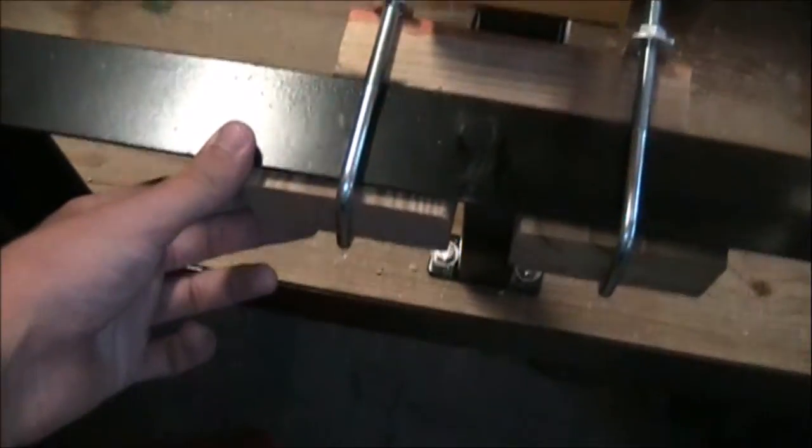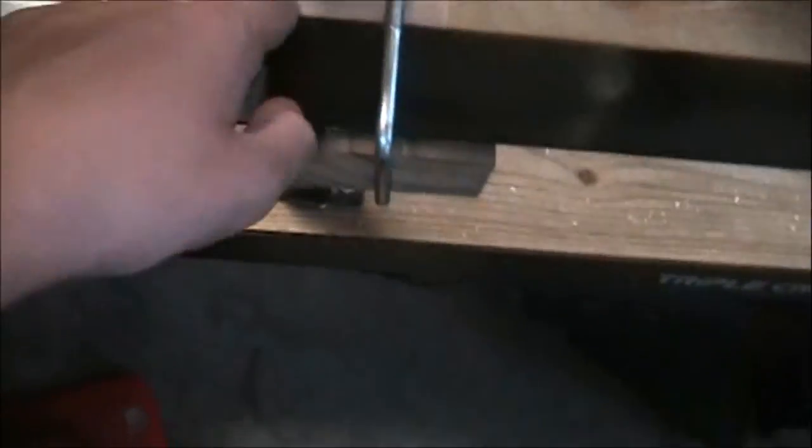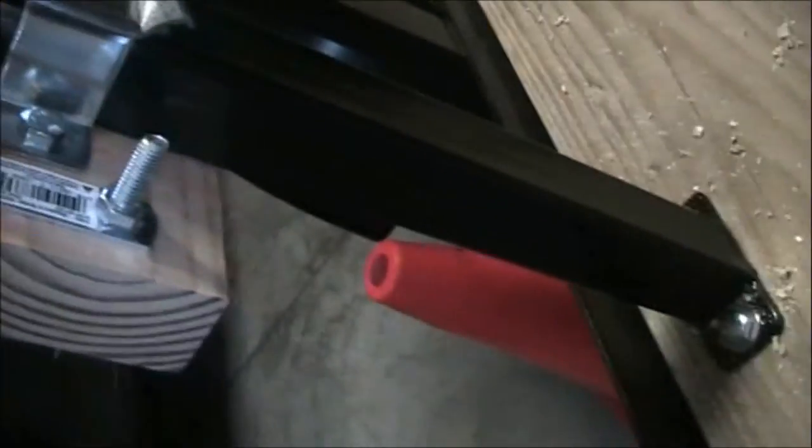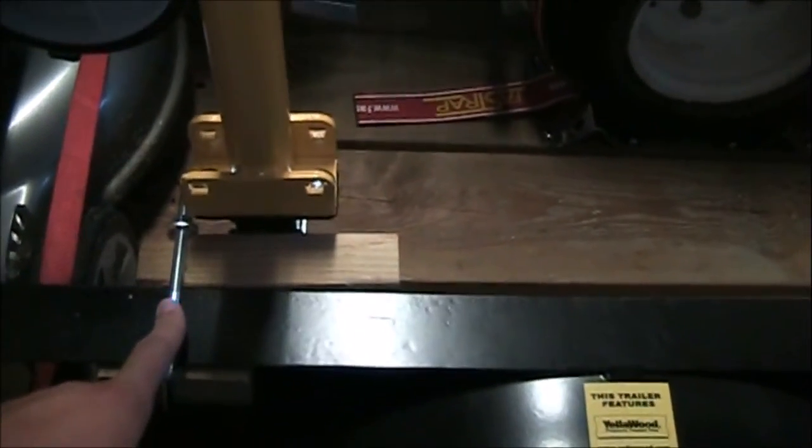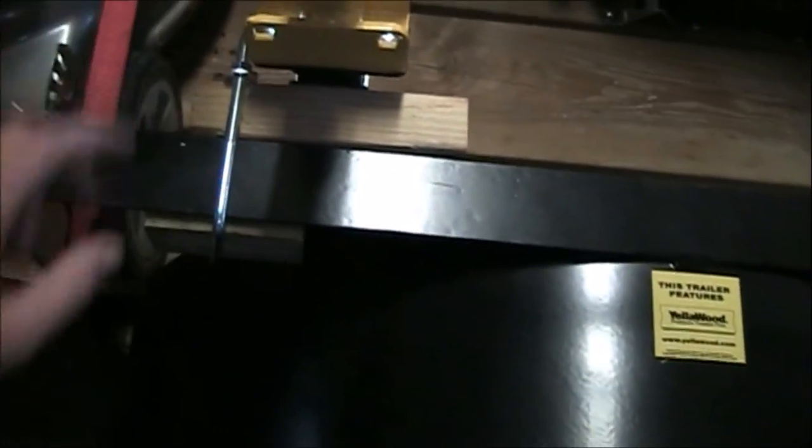I used U-bolts on either side around a piece of pressure-treated 2x4. We spaced it out away from the frame because the angle iron extends a bit under the board, so it goes through the wood instead of the frame. Then I used lag screws instead of the self-tapping metal screws the extension came with, and bolted it to the 2x4. The U-bolt comes around the frame and it is super solid — it shakes the entire trailer. These are 5/16-inch by 2-inch wide by 5-inch long U-bolts, and we bought out both Tractor Supply stores in our town to get enough.